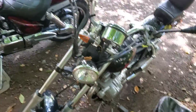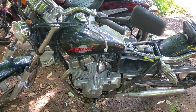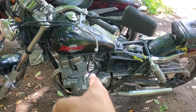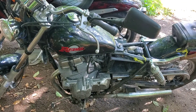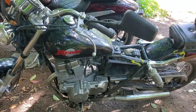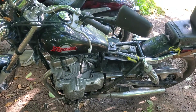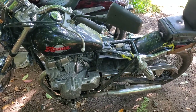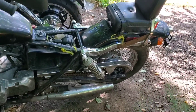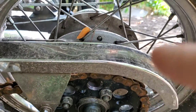This is my wife's little bike — that's a Honda Rebel 250. It's kind of apart right now. I took the carb off it the other day and cleaned that out; it wouldn't run without the choke on. So I cleaned it all out, took some sludge out, put it back together, and got it running.